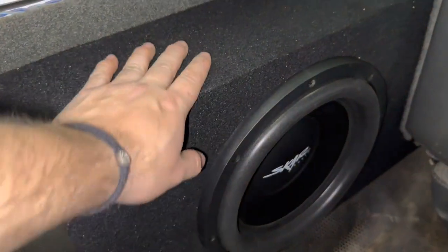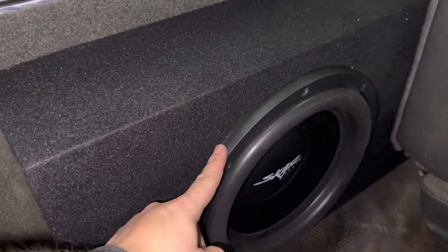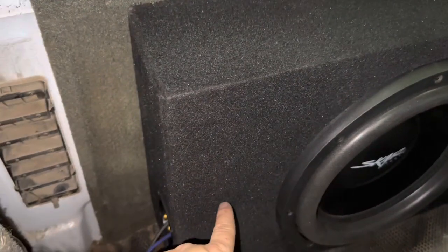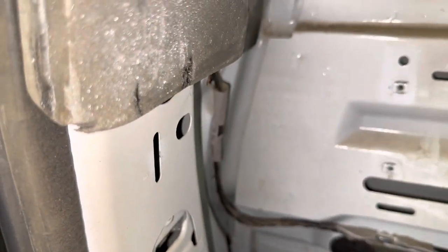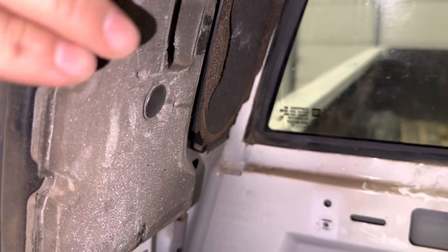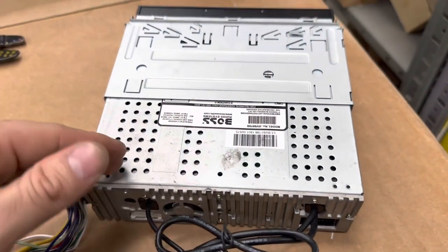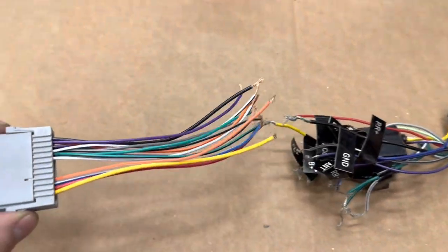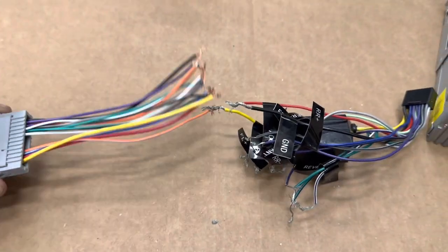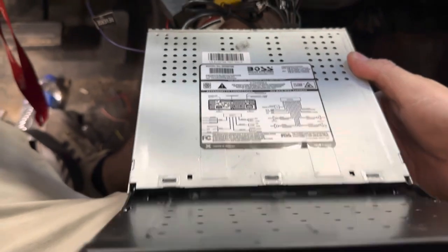My phone ended up dying on me so I kept working, but in that time I went ahead and wired in the sub and mounted it — I wired it to two ohms. I ran the wires from the amplifier to the back of the speaker box on the side. I took off this pillar cover and I'm going to replace it, but before I do that I'm going to wire up the radio so we can get a sample of what it sounds like. Here we have the Boss Audio flip-up radio. I disconnected the harness from it so I can solder it connected to the factory harness adapter.